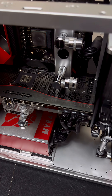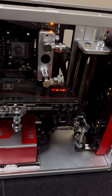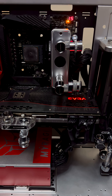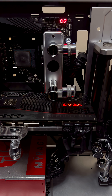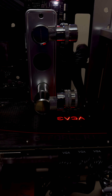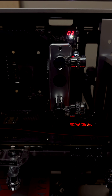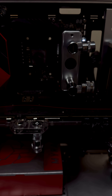This thing was running good for five years straight, but unfortunately it looks like the CPU has kicked the bucket. It goes to regular boot, IMC comes online, it goes to regular memory training, but unfortunately it doesn't initialize all the way. We get the white and green LED, and as soon as it goes to D7 here — see we get that white and green and zero — and it basically just stays like that until it's shut off.